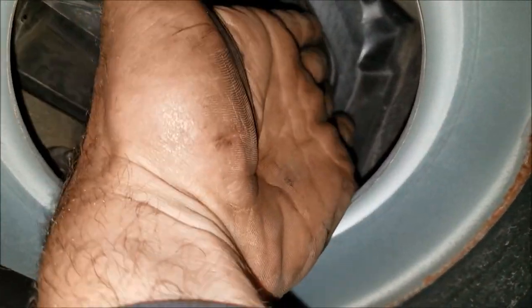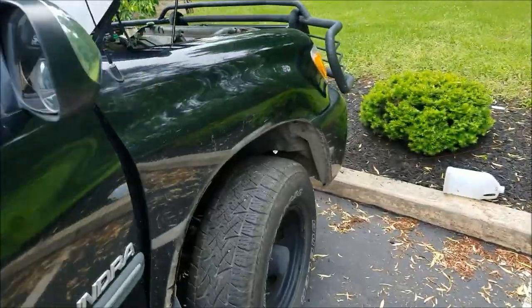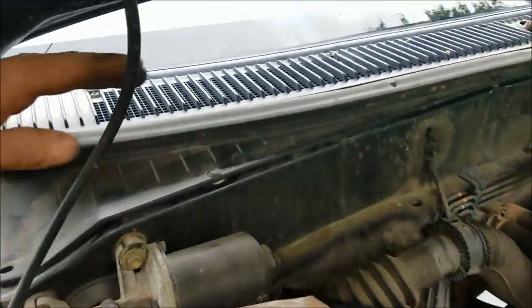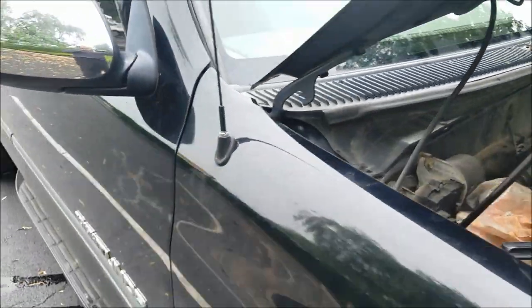So I think my fix is gonna be to come in here with some good silicone and basically run it around this whole joint. I'd love to seal it from the outside, but I already looked behind this fender and you just can't get there. The only other option would have been to cut a big access port right here, but that's opening a can of worms.